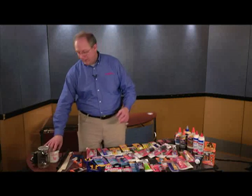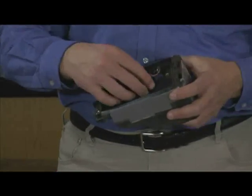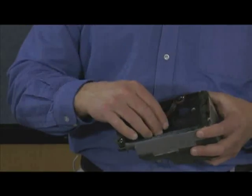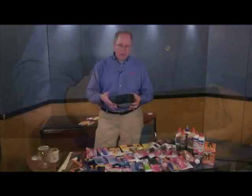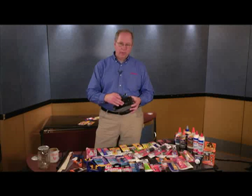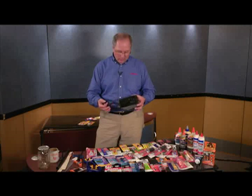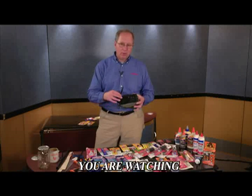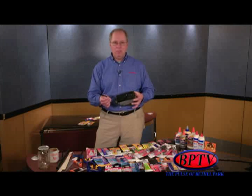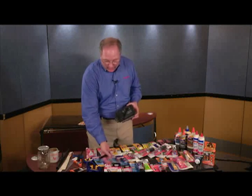This is a piece off a lawnmower engine — part of the air filter going into the carburetor. A lot of times people will break a piece of plastic off of it. Some people might try super glue to glue it on, but the trouble is this part has a lot of dirt, grease, oil, and gasoline. The solvents in the gasoline are going to dissolve the glue — it may bond quickly, but it's not going to adhere. In those instances, I like to use epoxies.